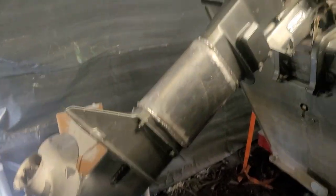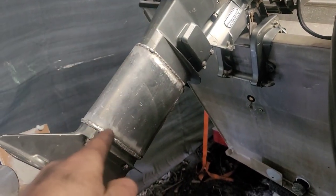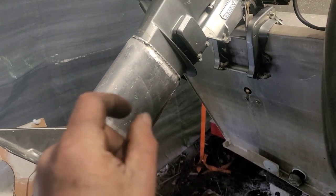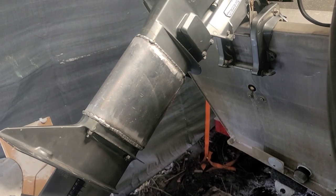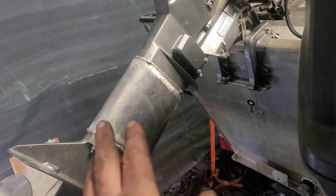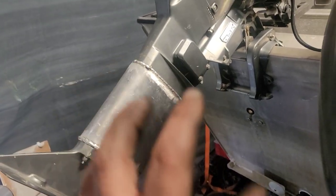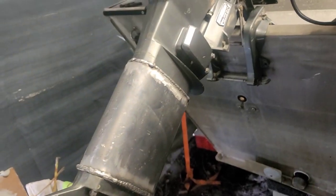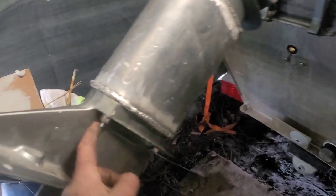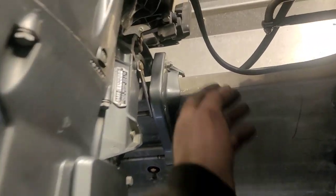Holy crap, I did it! That was extremely difficult. The water pump pipe I extended with a chunk of rubber hose and a piece of copper tubing with a little bit of electrical tape, because it's a 10mm hose and what I had was 3/8-inch copper tube — so I made it just slightly wider. The shaft all lined up, the shift linkage all lined up, and all the all-thread lined up. That was a pain to get all those things correlating together, but it's installed. I still need one more piece of all-thread, but it's essentially complete. I'm going to drop it down and see where we're at.